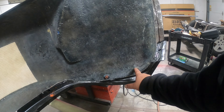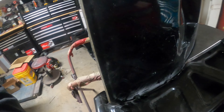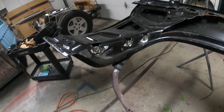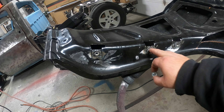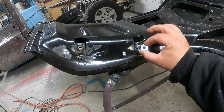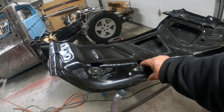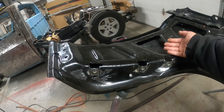After fitting this slosh tub, I made a couple of changes. We were going to bolt it in these locations — I had these clip nuts that I was going to put right here, but I didn't really like how that looked. So the new plan is we've now welded in three nuts. There were already three holes right here — I just made those holes slightly bigger, put the nut inside the hole, and welded it in. The plan is to put the slosh tub back, run the bolt, pull the metal right where we want it, then come back and weld up those cuts. After the cuts are welded up, we'll put in a little bit of sheet metal and close all this up so it will all be smoothed out.